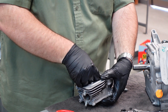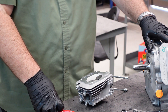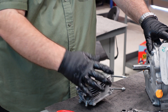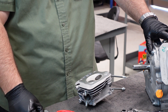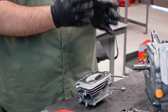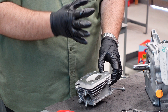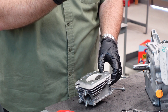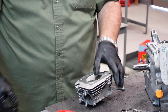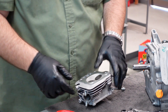There are machines that do this in factories, but we visited an old engine rebuilding factory in Houston several years back — they rebuild White Superior engines. There was a guy there whose job every day, all day, was to do it by hand. He had a little wooden dowel, and the big coarse valves he worked on were a couple inches in diameter. He'd sit there and spin them, check them, and after two or three spins he'd move to the next one. He hand-lapped every valve.